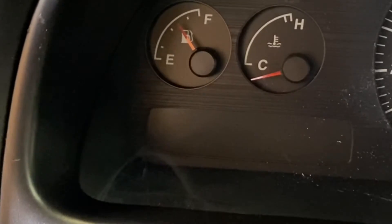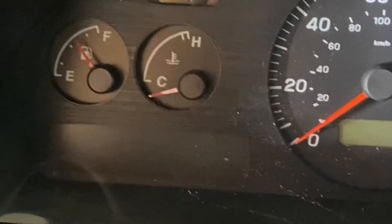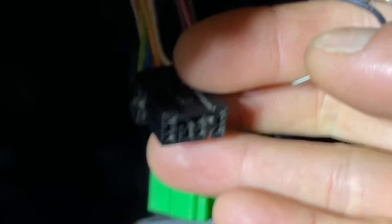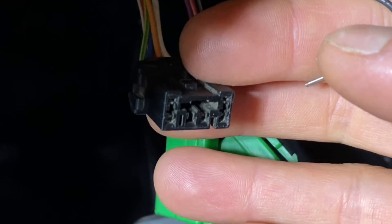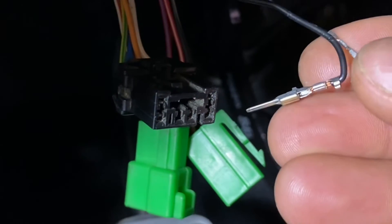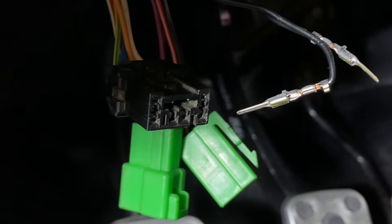This sucker should be ready to go. The last thing you'll do is turn your key back to the off position, go back down to your diagnostic connector, and remove that pin — you don't want to leave that pin in after you've cleared these codes. Then bundle these connectors back up in a safe location, and your ECU should be good to go with no more codes in your ABS system.